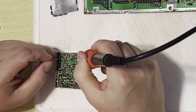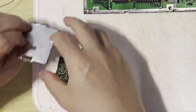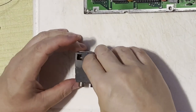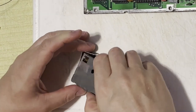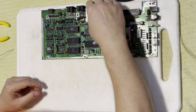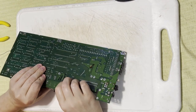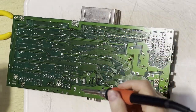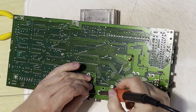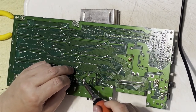Coming back to the RF modulator, I cleaned it up as well, and I reattached the RF modulator's board to its shield case. You can see that RF connector is in much better shape. I also had to use some Deoxit on the toggle switch. Not bad — it could have been a whole lot worse. Let's get it reinstalled into the board. The Composite and S-Video are not going to work without the RF modulator installed because it has pass-through circuits, so we'll have to reinstall it. If I had my way, I would remove this thing, but it's not my property to destroy like that, so I'll restore the RF modulator.